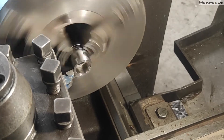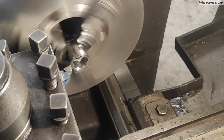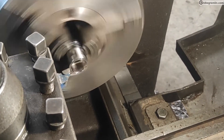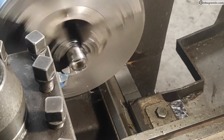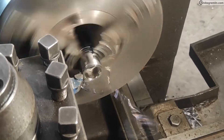Next, I wanted to make the tool fit as tightly and snugly as possible in order to make it more difficult to cam out — to fit just right. So here we removed just 0.05 millimeters of the outer diameter, roughly speaking.